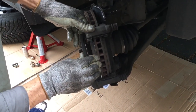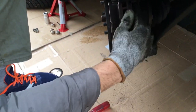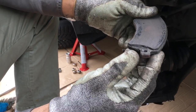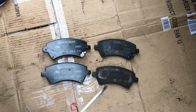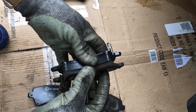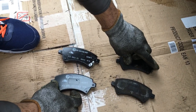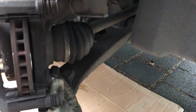The brake pads are here — just take them out. You can see they still have some material left, so they are not that bad. The brake wear indicator has not touched the rotor yet. However, it's fairly close to the last few millimeters of thickness, so it's a good idea to change them now. Before installing, check that the new and old parts match. The profiles are the same. Note that the brake wear indicator is only on one side.